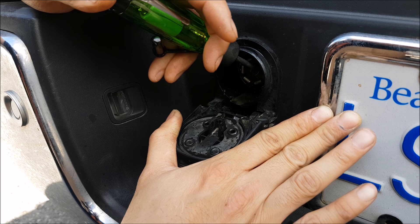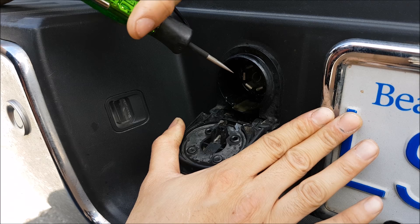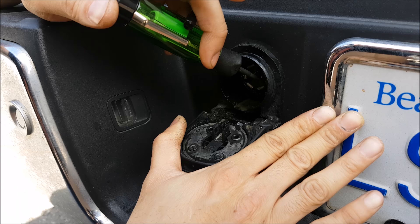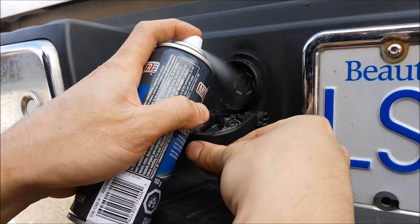The first thing we want to do is check the truck itself. We go through all the pins and make sure they're actually working, to confirm it's not the truck itself. So far everything is looking really good. This is a cool little snap-on tool — as long as I touch the truck I am grounded. Most traditional test lights you have to hook up to the battery somewhere, but this one I don't. We've confirmed the truck is working fine and all these pins work really good.